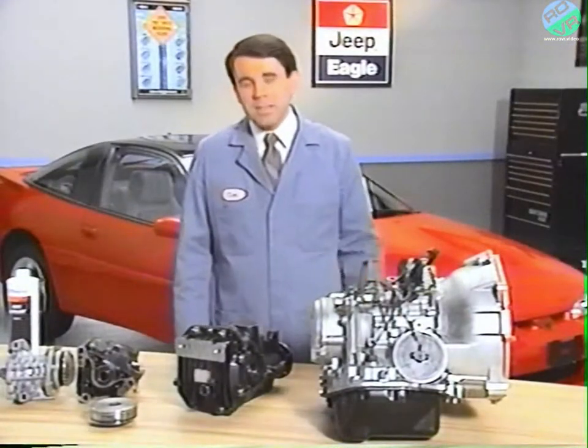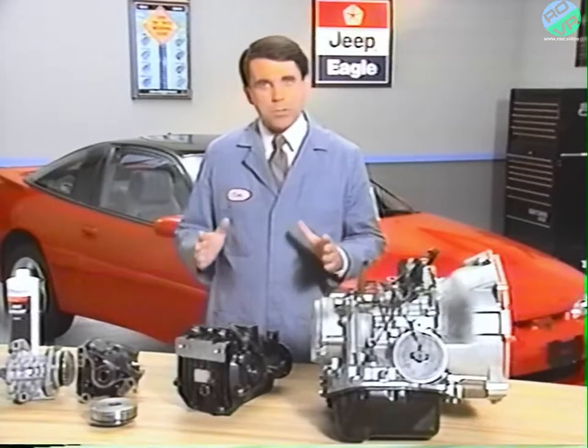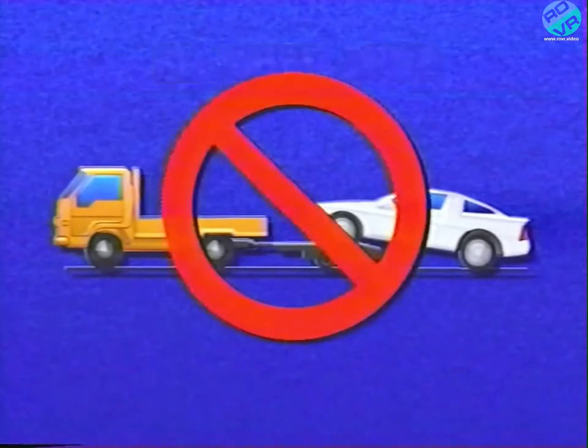As we've seen, the transaxle viscous coupling is designed to equalize torque between the front and rear axles. So you can imagine what would happen if you tried towing an all-wheel drive vehicle with one axle on the ground and the other on dollies or on the wheel-type lift of a wrecker. With this type of arrangement, not only may the wheels on dollies or wheel lift attempt to move, but the viscous coupling may be severely damaged in trying to move the stationary wheels.